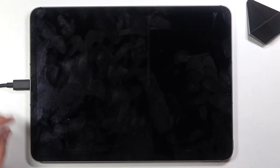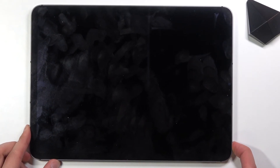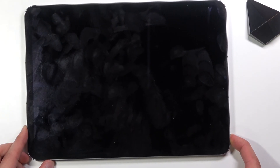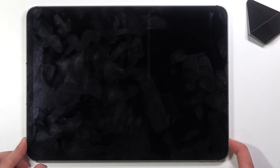So anyway, that is how you boot it into DFU mode. And if you want to leave it, it is also not straightforward — because why would it be? You have probably already tried holding the power key, which will do basically nothing, as I will show right now. So to turn it on, what you want to do is again press volume up, volume down, and start holding the power key. Really easy — self-explanatory. Everybody should probably know that by default. That is sarcasm, by the way.